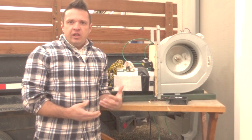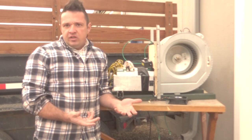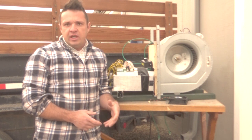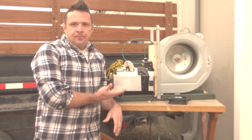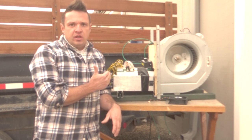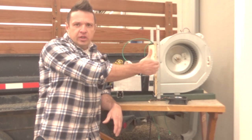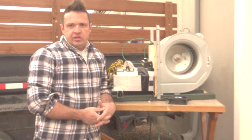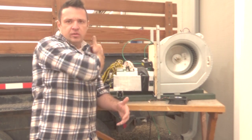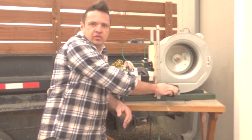So adding this blower costs roughly the power equivalent of one of the original small fans. In theory, if we could replace these S9s with one S19, this blower should provide the same airflow but at probably 25 to 30 decibels less noise, and at that power level the blower still has plenty of reserve capacity. Furthermore, the airflow comes out at much higher pressure, which allows it to be ducted both on the intake and exhaust sides. For example, if you wanted to mount this in an enclosed space, you could run a long duct bringing cold air in — something much easier than using the original axial fans.